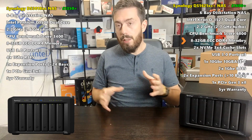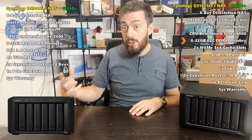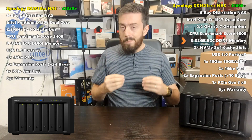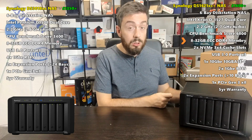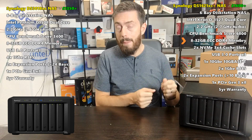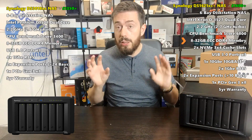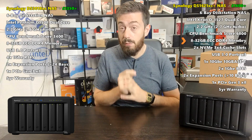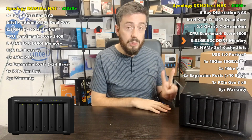But the 3018xs, even if you install that card that we mentioned earlier to try and get that improved performance externally, you're not going to hit the same highs. Not just because of the 10 GBE port. The 10 GBE port plays its part. But the Xeon-based processor inside there is the better of the two in terms of general file handling and having a fantastic floating point. So the external performance is better on the 1621xs for two reasons.